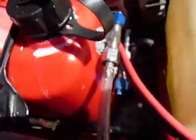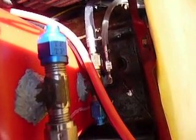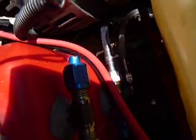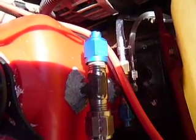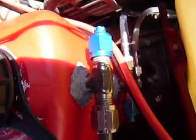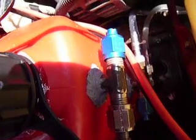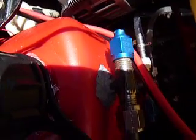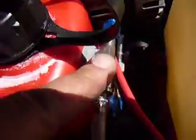This is a reservoir tank right here. The very bottom union down there is feeding the cells. The center one here is the gas coming in to the reservoir to the engine, and that's in the middle. The level hopefully just stays above there, and that coalesces the vapor and water out of the gas. The gas outputs right at the top here, and at the moment I've just got it coming out straight into a drain.